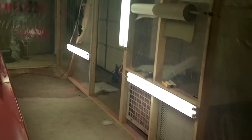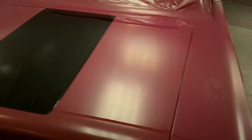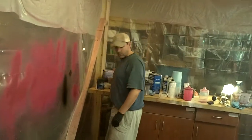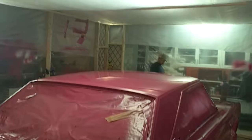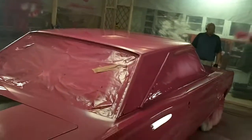The airflow across my paint booth was woefully inadequate. I think a big reason I have so much trunk trash is the fact that there were no filters on this corner of the room to suck fresh air in. What we did at the last minute was take a razor blade and slice up the plastic over here on this side to let the air cross-flow across the trunk of the car. The amount of trash over here on the front of the car, which is where the filters are, is a hundred times less than what we got on the trunk.